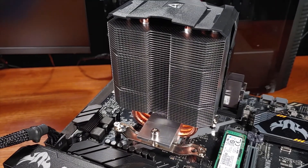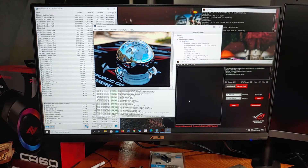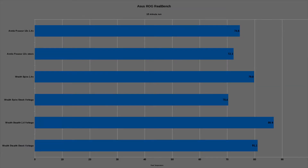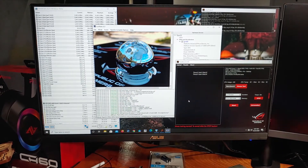The first test we're going to look at will be ASUS's ROG RealBench test suite. At stock settings, the Ryzen 3600 reached a maximum temperature of 72.3°C during a 15-minute test run. Auto settings allowed an average all-core boost to 3.95 GHz, which is quite good. Moving on to the overclock test, the maximum temperatures recorded were 74.6°C, with the voltage locked at 1.4 volts and the LLC set to high. These results were so close because the cooler afforded the stock configuration decent headroom to keep bumping the voltage and clocks up a little bit.